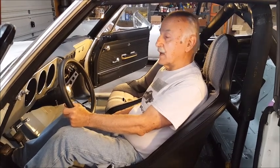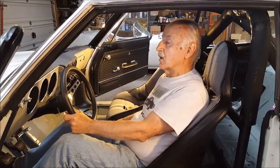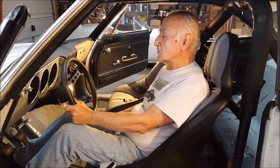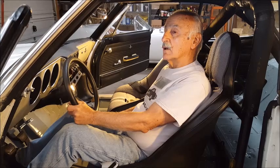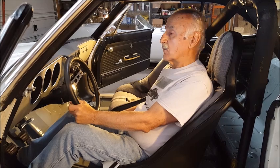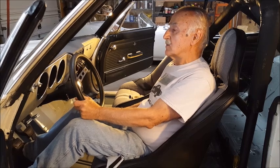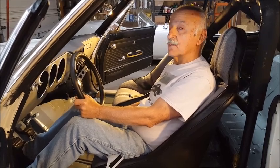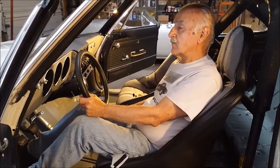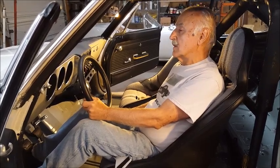I felt the car slow down, and I looked at the boost gauge, the big one in the middle, and it was showing 0. Well, I'd lost something on the left-hand side of the engine. I didn't know what it was, but there was no boost on the left-hand side. So I looked over to the right-hand side, and it was showing 20 pounds, 25 pounds boost. So I thought, well, I've got to finish this run. So I went ahead and opened the throttle wide open. The boost on the right-hand side went to 30 psi. Managed to get through the run with 30 pounds boost on the right-hand 3 cylinders. No boost on the left-hand 3 cylinders, and we averaged 171 miles an hour on 3 cylinders. That's 88 cubic inches. It was a good, strong run.